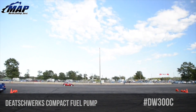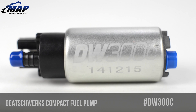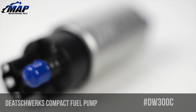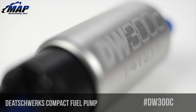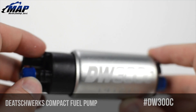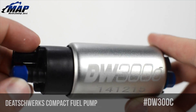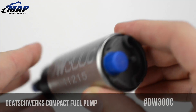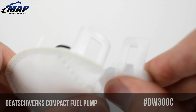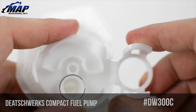This pump is really going to change the fuel pump market. Never before has there been a direct fit pump that could flow 340L per hour. The DW300C has the same excellent fuel delivery of the DW300 but in the housing of the very popular DW65C. At 43 PSI, the DW300C flows 340L per hour at 13V, meaning you will have the fuel to support all stock frame turbo upgrades on the market without modifying your fuel sending unit.